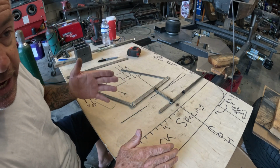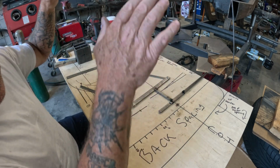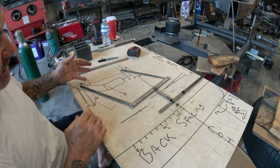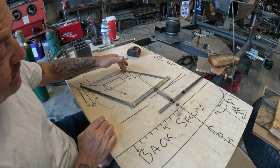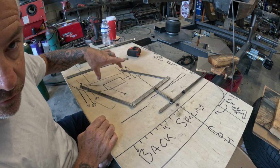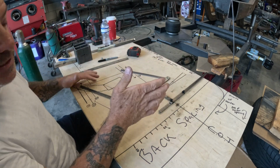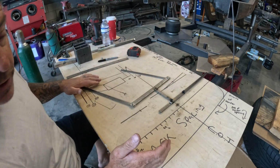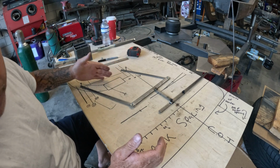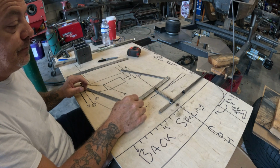So you take a Nissan, when you air a Nissan out or a Toyota out, and you see when they're laid on the ground, the wheels are pointed forward. That's because the tie rods are not inside of these pivots. And the way to correct it is cut and re-weld and adjust your center link so your center link falls inside of your pivot zone. So I hope this helps.